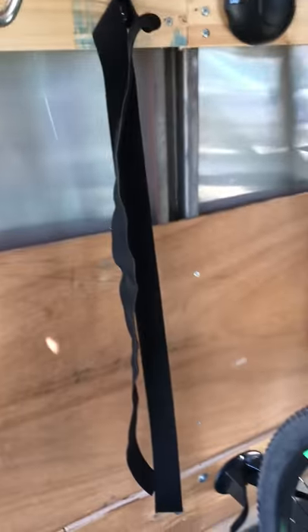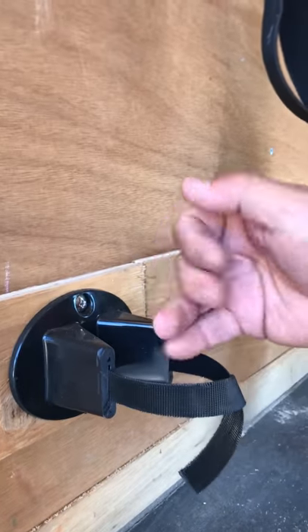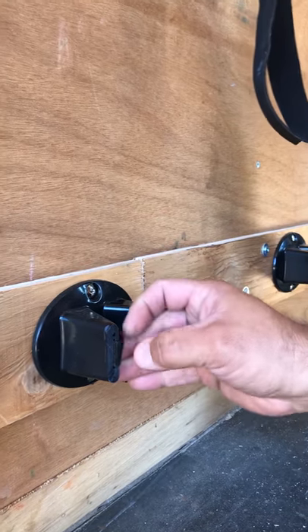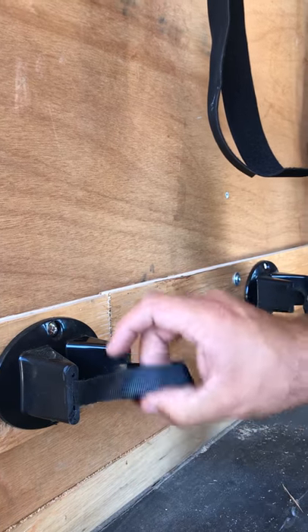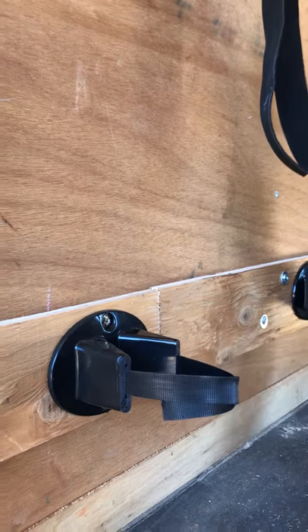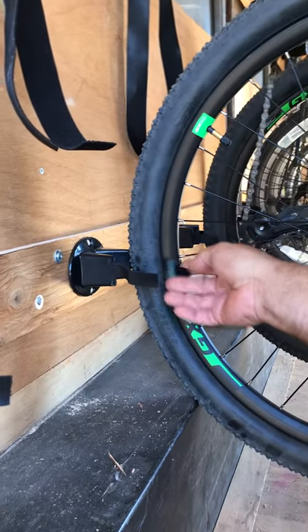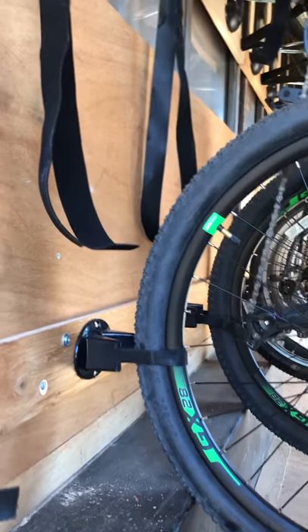The bikes don't move in transport, which is a plus. The last thing is down here on the bottom — we put all the wheel chocks at the bottom. I got my cutoff wheel on a grinder and carefully cut off a quarter inch of plastic. Once I did that, I took a flathead screwdriver and cleaned these slots, then cut about 12 inches of one-inch velcro double-sided hook and loop. I took these off, threaded them from the back on the inside, and pulled them out.